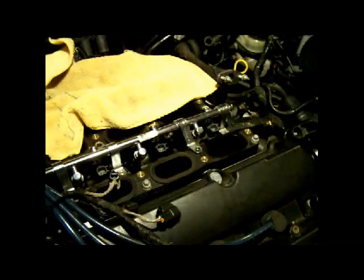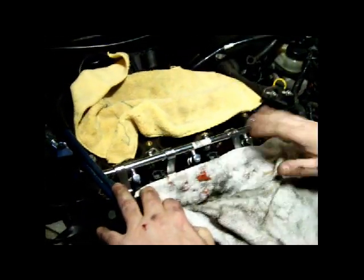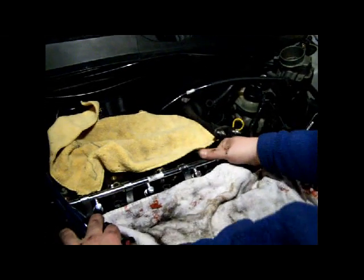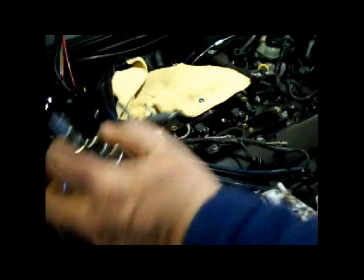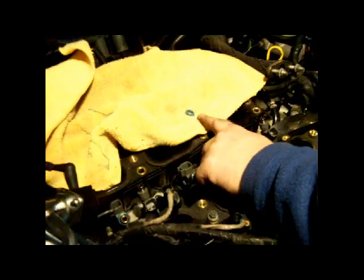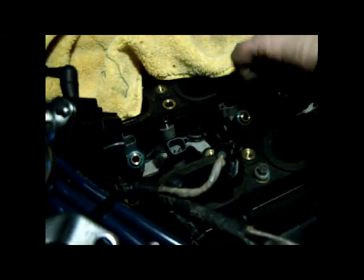I've gotten those bolts out and set them aside. Now we're getting ready to just pull the fuel rail off of the injectors. When you do this, start from the far end of the fuel line — the fuel line comes in on the left, so start on the right. You can see that whole assembly just pops right off. When we pulled it out, we actually got an injector that came out with it, which is fine — no big deal. I'm just going to pull that out of there. There's an O-ring that popped off, and I've got another O-ring stuck in here. We'll have to take that off and make sure we haven't lost any O-rings in the process.